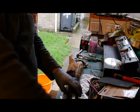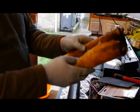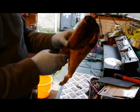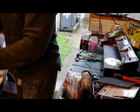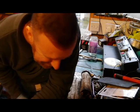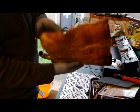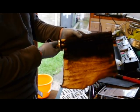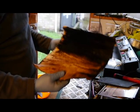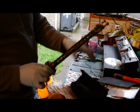You will need a friendly persuader. Remember guys, leave the nuts - put them back on there and tap them down. This is not what I expected. I looked at this exhaust originally and it does look really new. The wadding actually is quite good until you get to the top end - that is rock solid, absolutely rock solid. When I first got this bike and the guy opened it up, I found this inside. Please don't use old oil in bikes. The wadding is thick and then you get inside and see what the problem is.